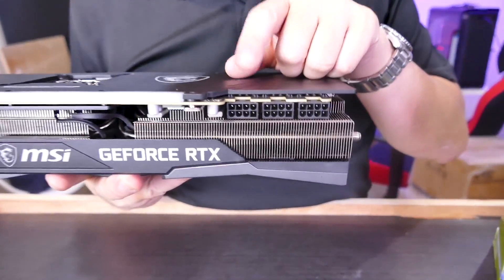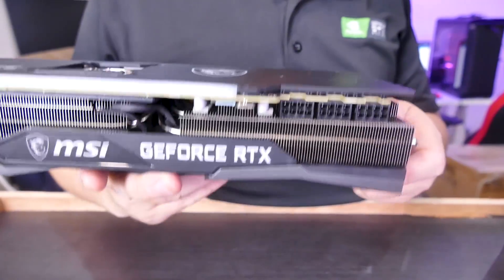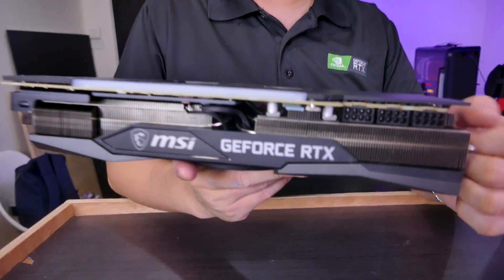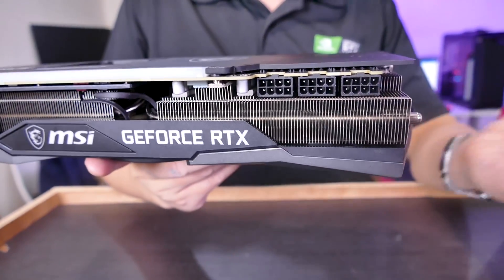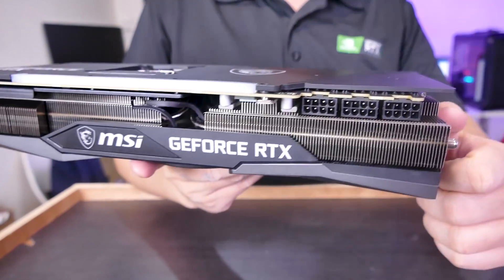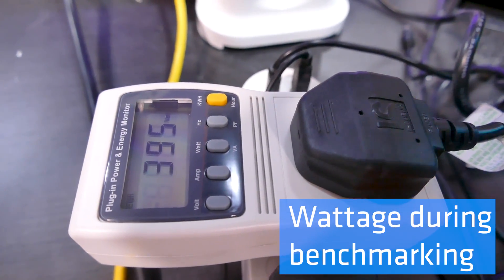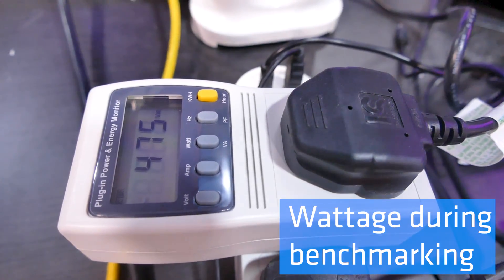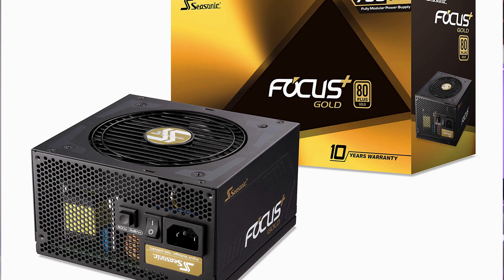On the surface here is the graphene backplate with a very nice finish featuring the MSI logo and the words GeForce RTX. If mounted horizontally and you look into the case, it gives a great effect. Regarding the three times eight-pin power connectors — does this card actually need it? Since each eight-pin has a rating of 150W and the second and third connectors were drawing 60 to 70 watts according to HWiNFO64, only having two connectors would max them out. The third connector is very much needed, especially for overclocking. The PSU used for testing is the Seasonic Focus Plus 750W 80 Plus Gold.